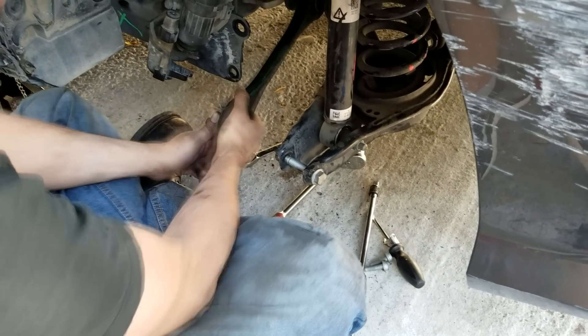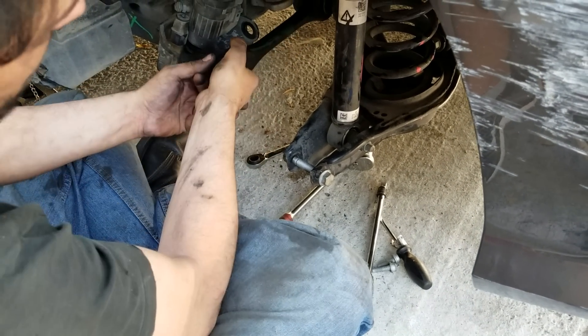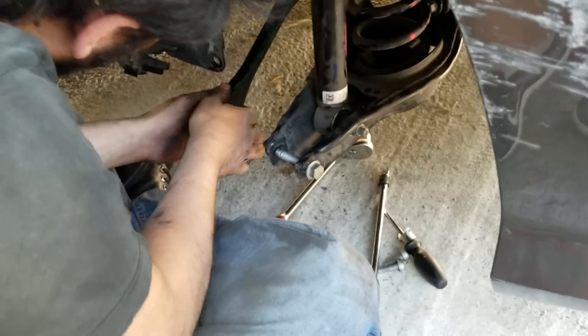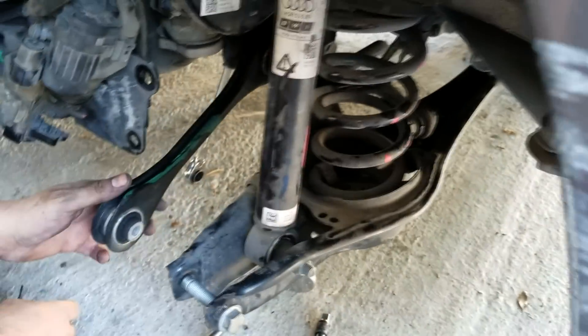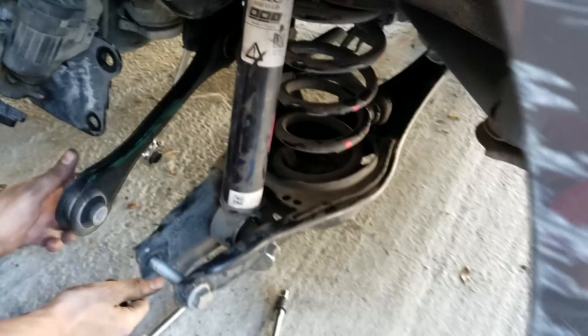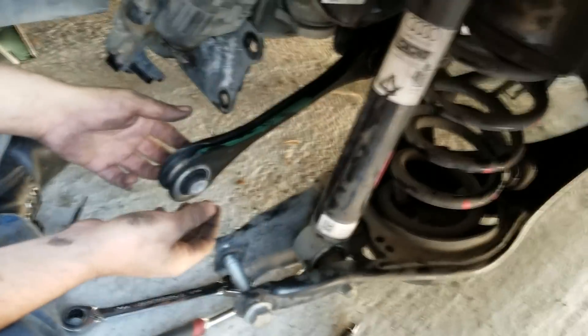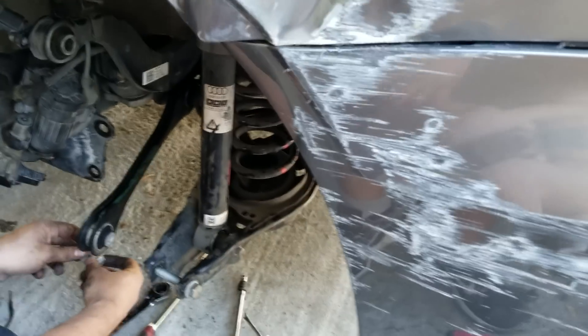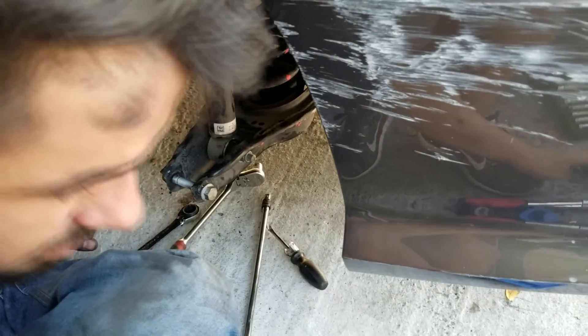That's what I'm talking about with the preload, because if this is tightened down it won't have any movement and then you'll break this bushing — it needs to go on just right. You'll break it as soon as you put the car down. That was a lesson on preload from Turbo Mike. You see this pink marker? Anything that visually even looks like it gets touched, the insurance company will go and draw on it. That pink marker doesn't necessarily mean it's broken, like that spring — I don't see anything wrong with that spring, Turbo Mike doesn't either. But they would replace it just for liability reasons, and all this stuff added up — they'll total the car.